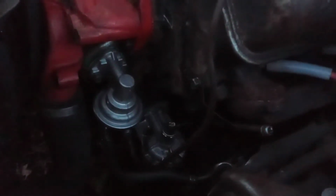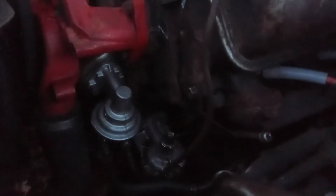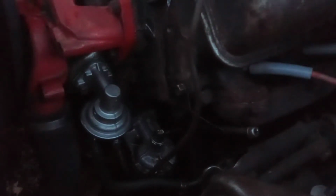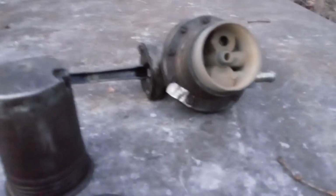And we were able to do away with the fuel filter, because that fuel pump that I just showed you is not original to the car. The original one, if you look it up, actually has dual vacuum ports on it, and that's for the vacuum wipers. But we're going to get rid of all that garbage there. And don't get me wrong, I like the vacuum wipers. They're cool because they're original to the car, but that's not what I'm calling garbage. I'm calling this particular style seal here and that diaphragm in there garbage because they leak.